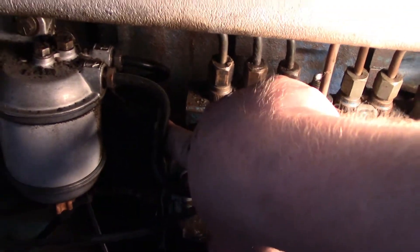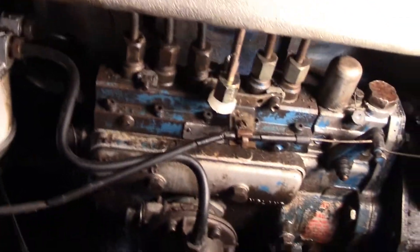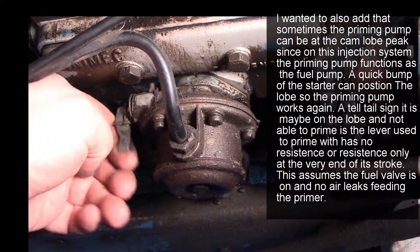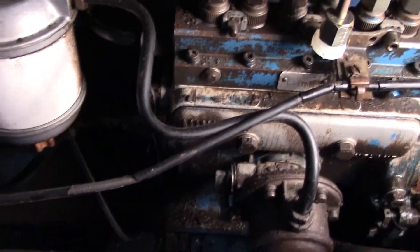There's a little nut on the back here on this Ford. Once you get that nut just loose — you only need to loosen it, don't need to take it off. We'll go through on the prime pump and give it some pumps. Sometimes it can take quite a while — make sure that's loose enough back here.